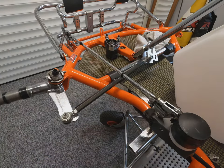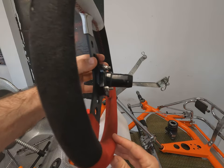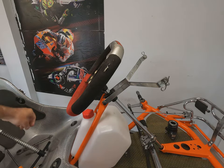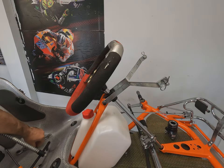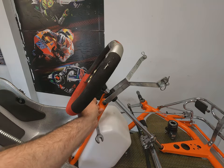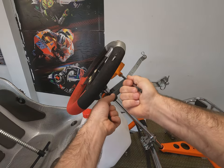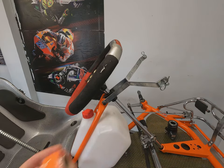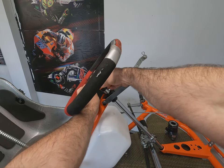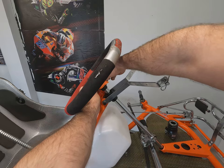Now it's time to install the steering wheel. This steering wheel has an angled boss on the back already fitted — it's only got one hole because it's a larger M8 bolt; some are M6 with two fixings. It's important when you install this bolt to install it facing downward, so if the nut does wobble loose you've still got a chance of the bolt staying in and the steering wheel staying attached to the column. There's nothing worse than a stuck-open throttle or a steering wheel coming off in your hands. As extra security I wrap a little bit of silicone tape around the nut and bolt, plus it has a nordlock washer — belt and braces to stop the steering wheel working loose.